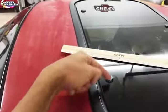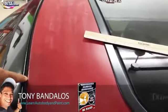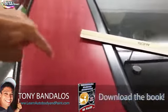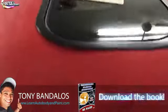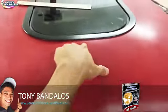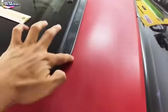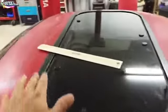I'm using these as markers to the edge of the roof. We're looking at seven and three-eighths inches — and that's even on both sides, so we know it's centered. We've got eight inches from this edge to the edge of the roof, and seven inches over to where it bends into the corner. That's our alignment.